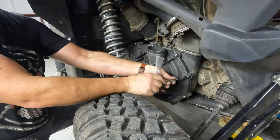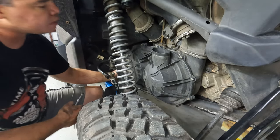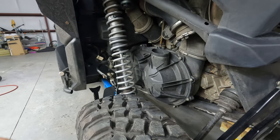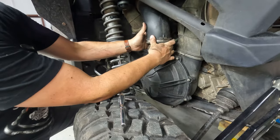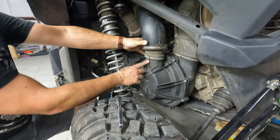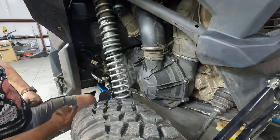I'll tighten all these up just enough. And then I'll go back around and do a final torque. Make sure I didn't miss any. Little self-quality control here. All right, there we go, all the way around. And I did miss one over here, so glad I double-checked myself. You can use a nut driver or a screwdriver for this part, for the clamp. But I just usually like to use the 7mm on a ratchet. Just makes life a little easier for me. Usually start at the back, work your way forward, and there's a plastic tab there, so that should fit right between there, and it also makes sure you know you've gone far enough, and this thing will make a good seal. To check everything else over, kind of the visual once over, make sure I haven't bumped or messed with anything, and I think we've done it today.